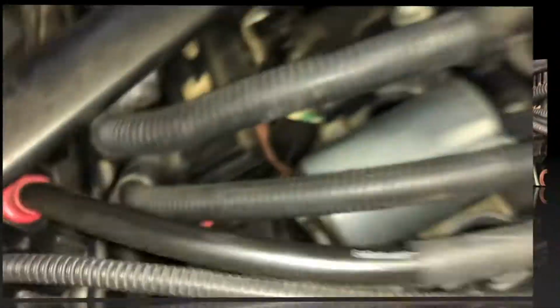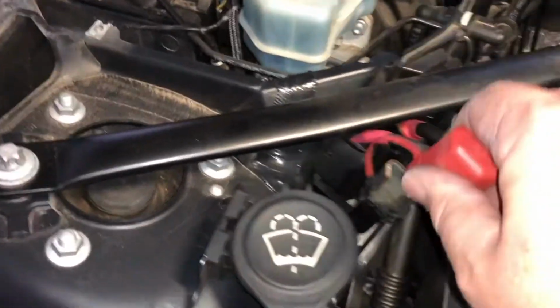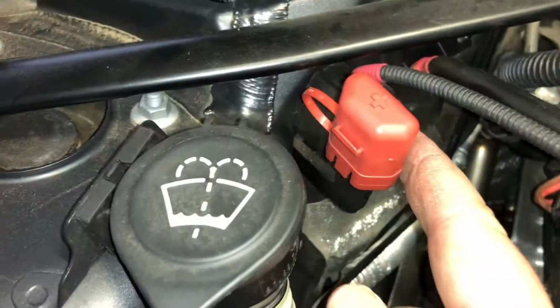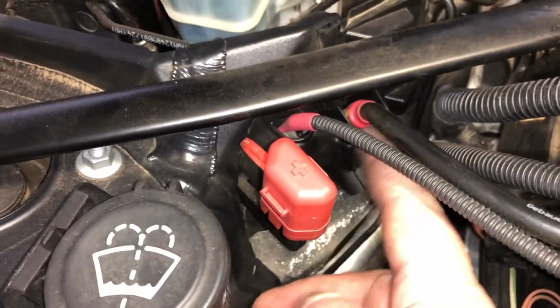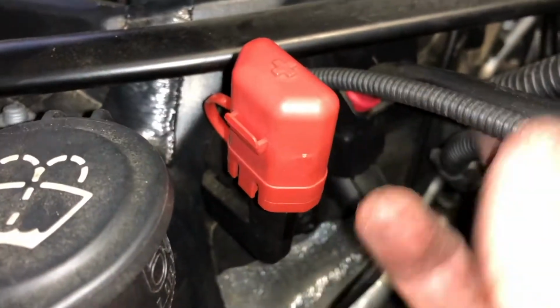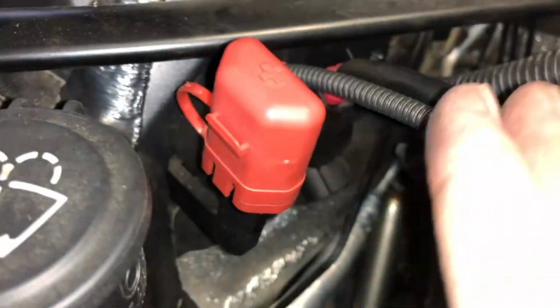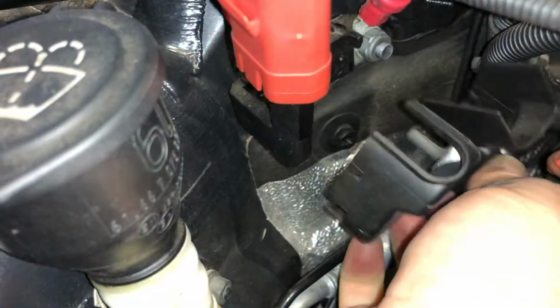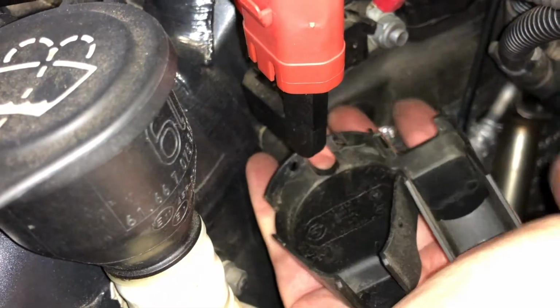So we're going to pull these bolts out and their washers, and then next here, where you've got your jumper battery terminal here, this is connecting in direct to the positive side of the battery. We need to disconnect these guys here so that we can lift this whole loom and get it out of the way, off the top of the engine. Just stick your finger under that little bit of plastic there and give it a wobble. That comes straight off. You see that there?